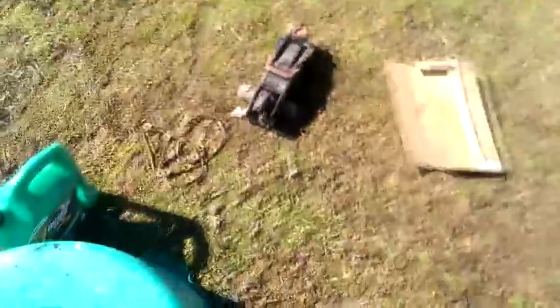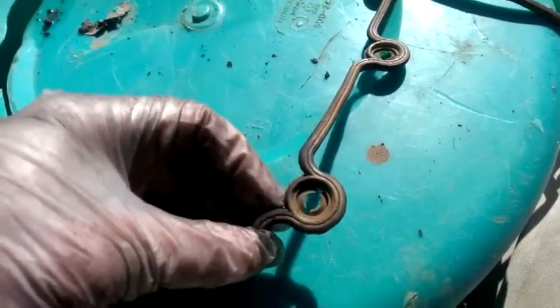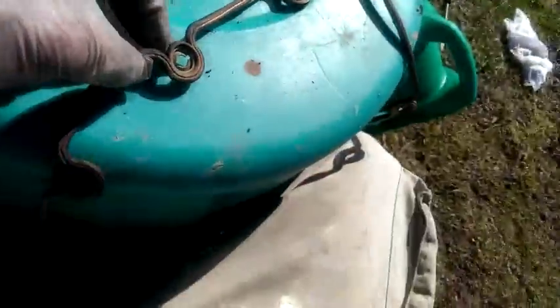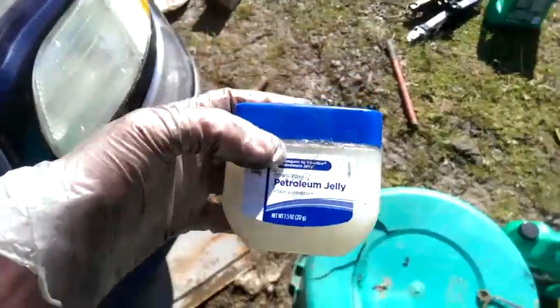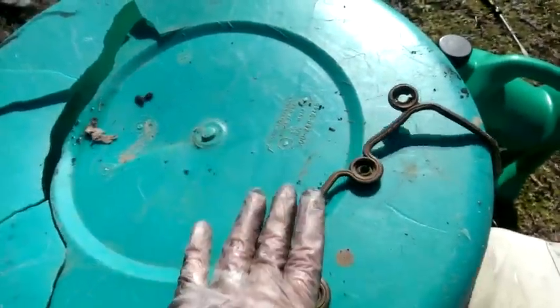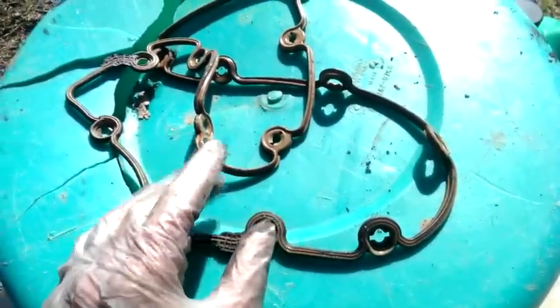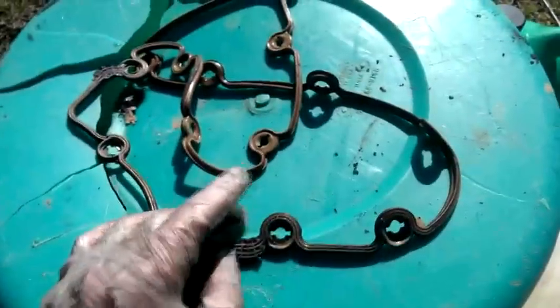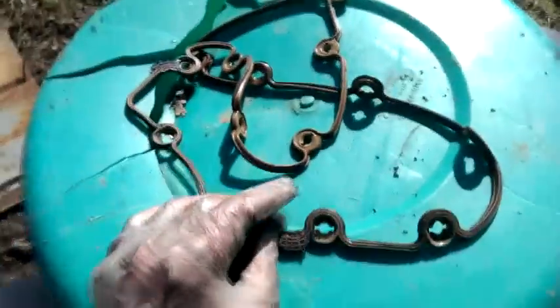Let me see if I can find the gasket. So on the gasket — you see how the gasket has this inner rubber ring there? Well, normally I use Vaseline — petroleum jelly — to hold a gasket in place just long enough so I can slide the gasket into position. Well, in this scenario, Vaseline does zero good. You have to wiggle the valve cover around so much that the gasket would just fall off.